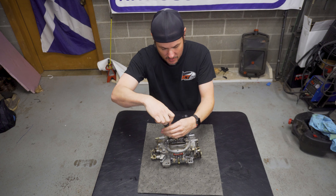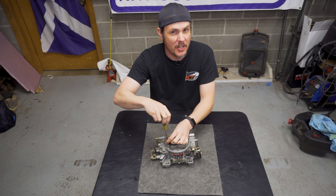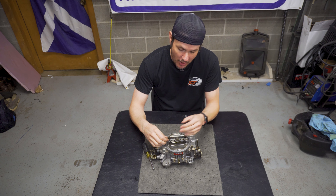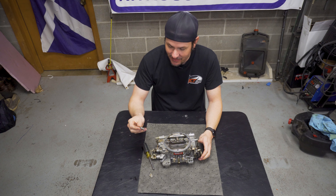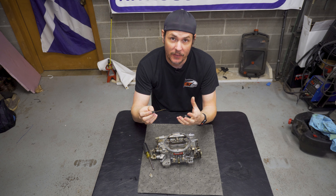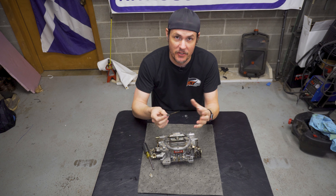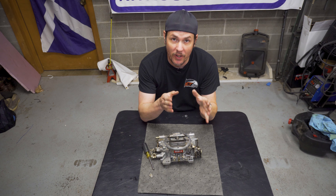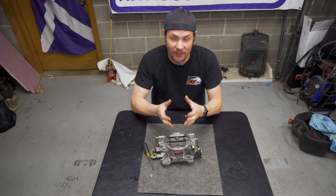This is really where it all starts, because if you look at a mass airflow sensor, all it is is a metering device — it meters airflow much like a carburetor does. The ECU uses that metered airflow to determine how much fuel needs to be injected into the intake in order to get proper combustion. On these devices, we have jets or metering rods that use the airflow being pulled through the carburetor to determine how much fuel. By changing these jets to bigger or smaller sizes, or adjusting metering rods and spring rates, we're taking an amount of air and adjusting how much fuel is being added for that amount of air.